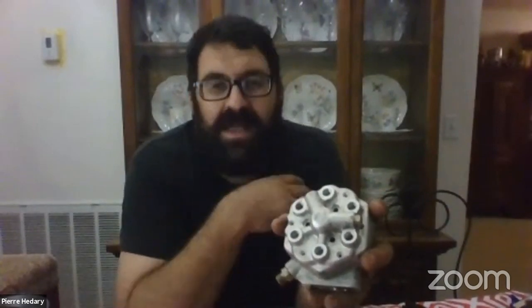For a dead miss, start cracking injection lines while the engine is idling to make sure all six, eight, or four ports on the fuel distributor have fuel delivery. Pull spark plugs and verify good spark. All pots need equal fuel delivery — this is why when rebuilding a fuel distributor you need a flow bench to make sure everybody's getting the same amount of fuel. A cylinder running super lean will eventually be ruined.